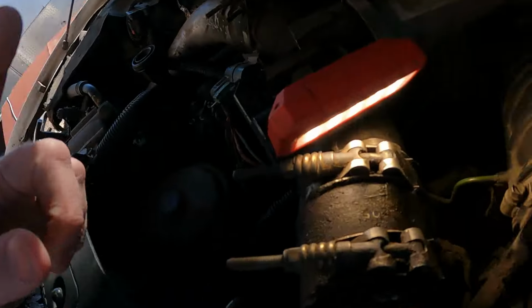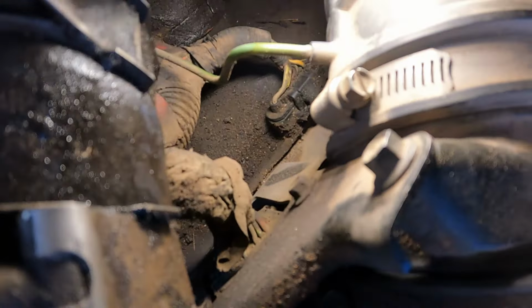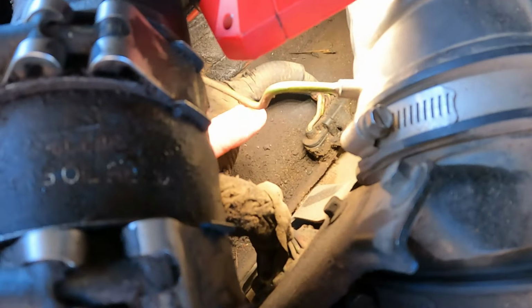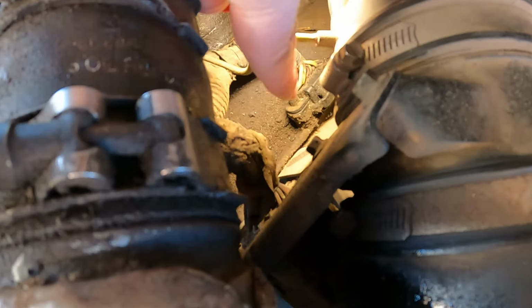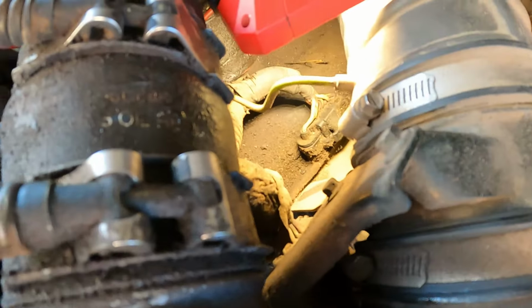So the next thing my brother-in-law, the diesel mechanic, told me to do was to ohm out the injectors. To do that, there's a little connector right down here on the valve cover. Need to get something to point with, but you can see right where the light's shining, where those wires are. So you take that clip apart, and then again, if you got this far and found me, then you know how to use the Google machine and the YouTube. There's 800 videos on YouTube about how to ohm those out.